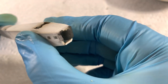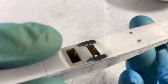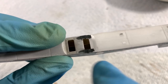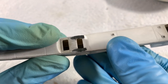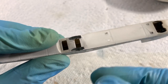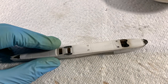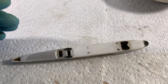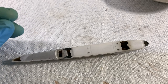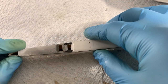I'm happy with the way the nose turned out and I'm going to stick with that. But over back here I'm noticing there's a little bit more work to be done — you can see there's a little bit of a hump there. What I'm going to do is take some thinner, wipe the paint out, put the tape back on, and basically work backwards and sand that again. I figure it's easier to check this now, so that when I get to the painting I don't have to stop and re-evaluate. Once I start painting I like to just go at it — put the primer on, put the paint on — I don't like to pause. So I'm going to go back and clean this up a little bit better and see where we're at after that.